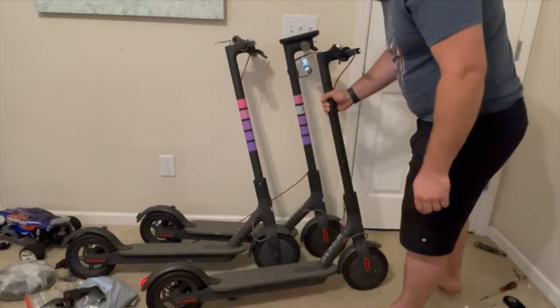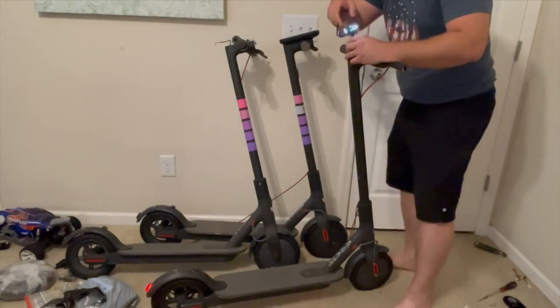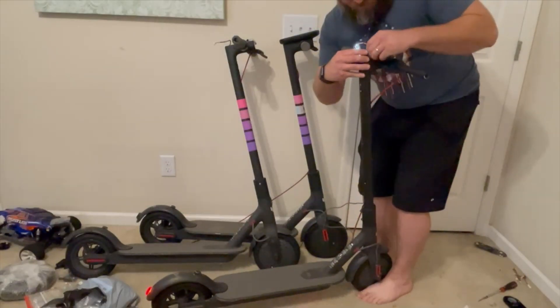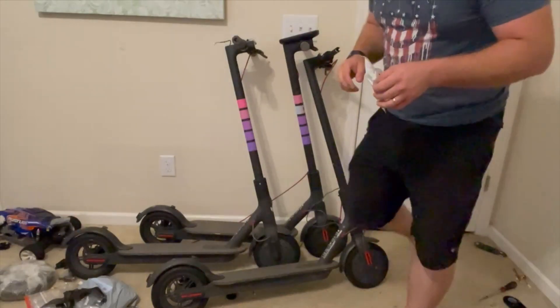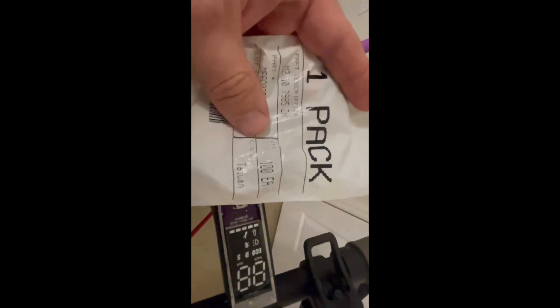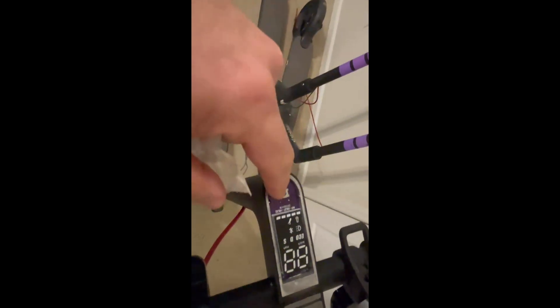She's ripping — showing 26 kilometers per hour. We know it's good! This one does have a messed-up front tire — I'm going to have to change the tube on that one. After you have that on there, get everything tucked down in here. Pull the cable out the side to get it clean, tuck it down in there. Tuck your extra wires in here underneath — be sure you're not going to pinch anything. All in there now. You're not going to have screws to secure it, but there are three spots inside — two in the front, one in the back. You're going to need an M2 by 10 screw. Just Google search that size — M2 times 10. You might find them at a local hardware store.